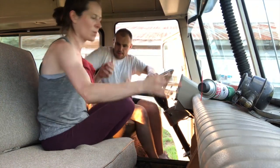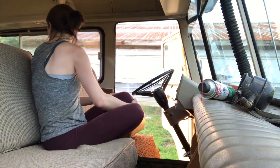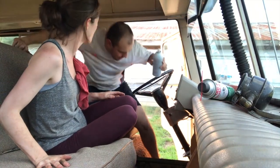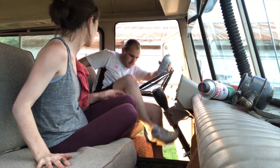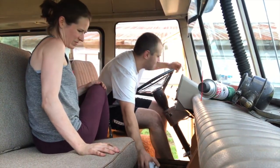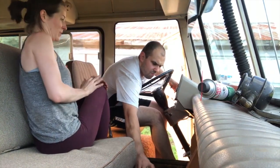Where's that starter fluid? Do we have to do it every time? No. Your dad says that they rely on it. So how do you get it to wean off of it? Just do it — persistence. Come on! And then Arthur's like, have you used the choke? And I was like — I wonder if that's why it didn't start by itself. So anyway, the choke cable is really stiff, so we're going to look into that and see if we can get it sorted out.